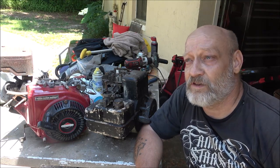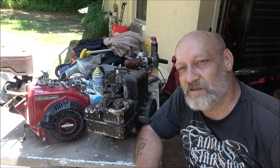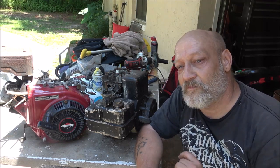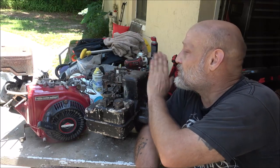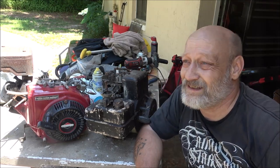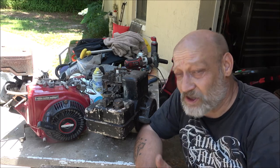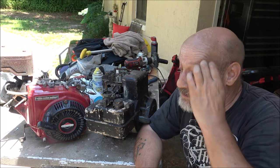But what I've done before, I've made tins. It's kind of a pain. It's not hard, it's just time consuming, you know, bending and drilling and banging and beating, cutting. What I've done before was took little PC fans, put a PC fan on the head and let it run across the fins, and that keeps it just as cool as if you had the tins on it. They look better with tins, but if you're going for functionality, that'll work just fine. You just get you a little battery, and just make sure that fan's running.